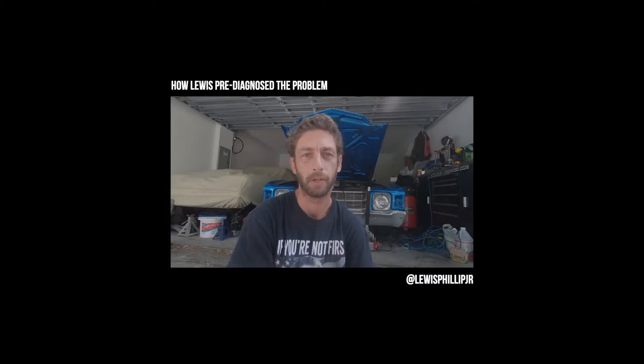Welcome to the vlog. Today we are back to oil leaks, because that's what plagues my life. Today it's the cam seal, I think. The way I was able to determine it wasn't the crank seal is because the belt was dry, even though the inside of the timing cover was covered in oil. We started the car and we saw that there was oil actually coming out of the hole in front of the cam.